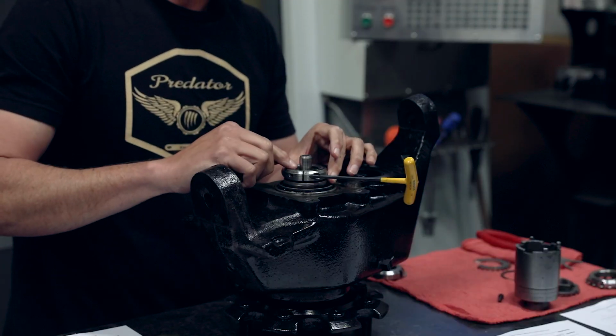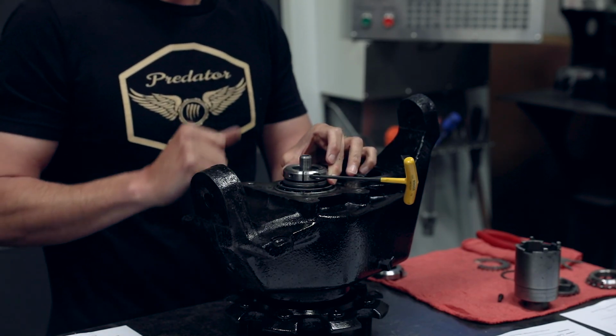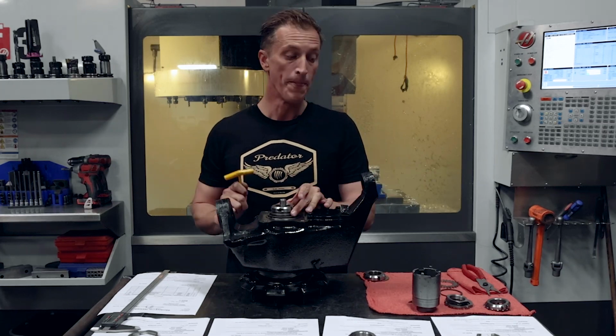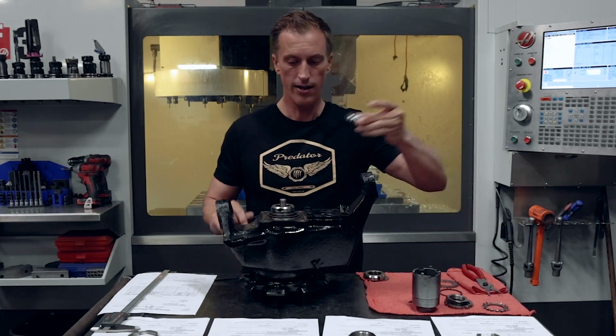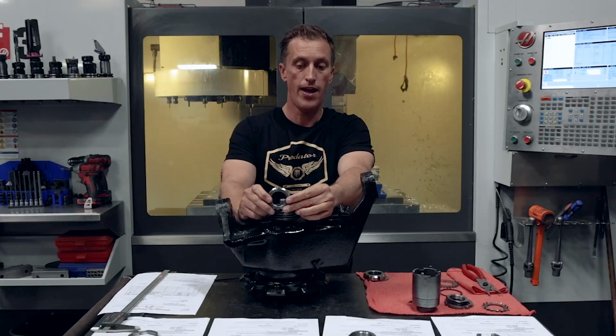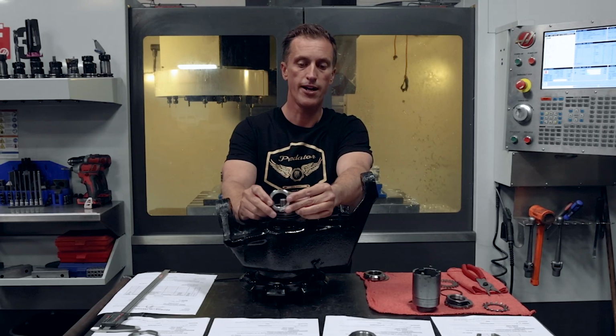If there's any deviation, you've got a problem in here, you're best to throw away that nut as well as that little set screw. If it's done correctly, it will not back off and you fully tested it. Where this guy, the Humvee nut, is set at 25 foot-pounds, and there is no sequence to make sure it is locked in place because there is no locking feature to it.